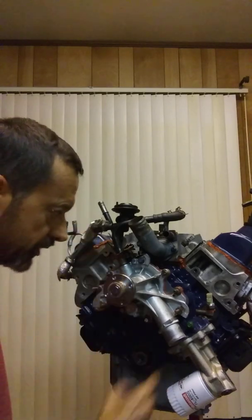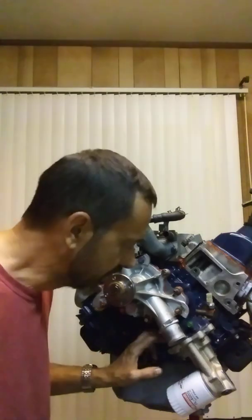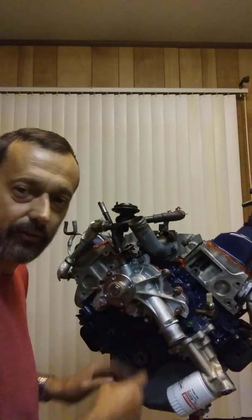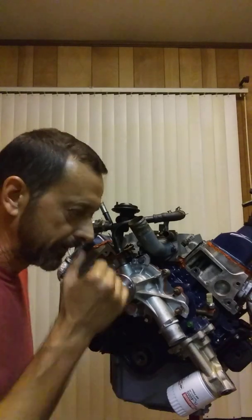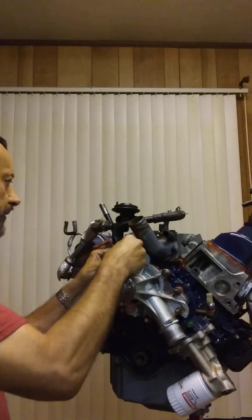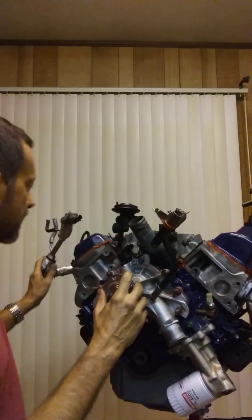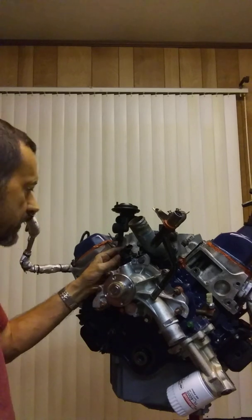So, that's pretty cool. However, if you want to mess with the oil pressure relief valve, you're going to have to take the timing cover off because it's located in the timing cover, not in the pump itself. What I came across when I was dealing with timing on this — let me show you here. First, let me get this water bypass thing out of the way, and I've got my EGR pipe disconnected and I'm pulling it out of the way so we can see this stuff.